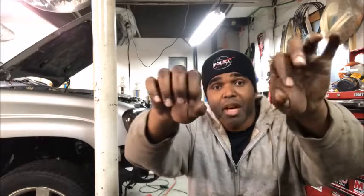Let me explain to you how it's going. Your front wheels — let's take this as the driver's side. This is how the routing of the CV joint and the front differential on the Trailblazer SS goes. So you go from the wheels and you go to the hub. From the hub, you have the CV joint that goes out. Now on your driver's side, the CV joint will go into a small front differential. From the small front differential, it will go through the oil pan — that's right, through the oil pan — and connect to the other CV joint on the passenger side. From that it goes to the hub, and once that front differential turns, that's where you get your front wheels to turn, and that's why you have an all-wheel drive.